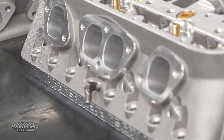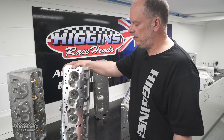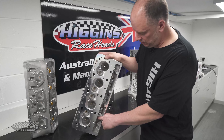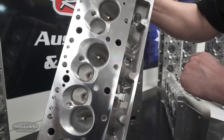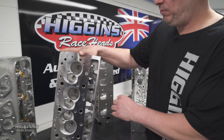It's a big problem with a lot of Chevys — the two exhaust ports through here run hot. This is a job we do here before you buy the heads, so you don't have to send it out to get done. It's already done for you. Same with the pushrod clearances — all done. They'll fit like a 7/16 with the right rocker combo, probably fit a half-inch pushrod.